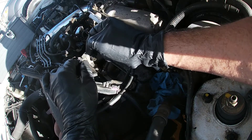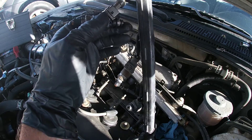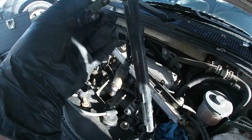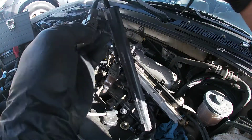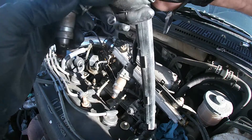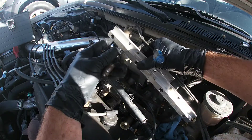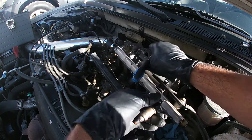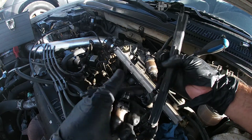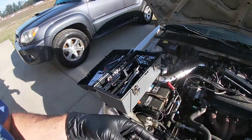What we've got to do here is take this metal clip off and the injectors will slide right out. You could use a knife or whatever you want — it comes off easy enough. My new ones did not come with one, so I definitely don't want to lose these clips. Then it just unplugs. Now you want to make sure you see these black o-rings — inspect your fuel rail and make sure none of those o-rings are stuck in there. Look how corroded some of this stuff is; I'm going to have to figure out how to get it clean.